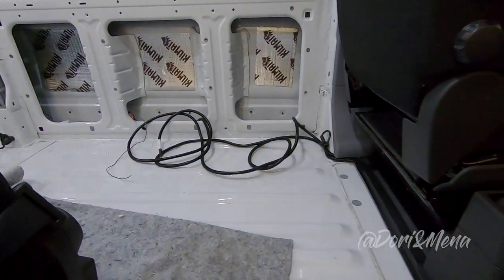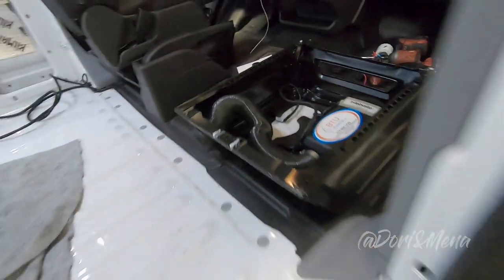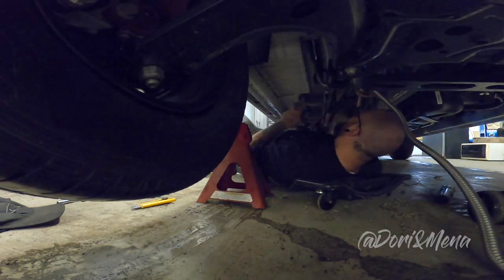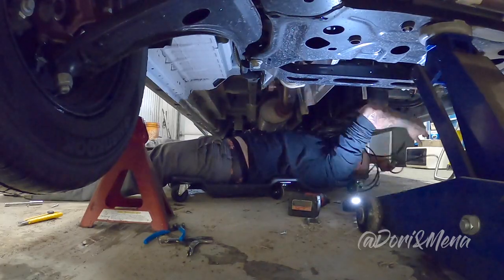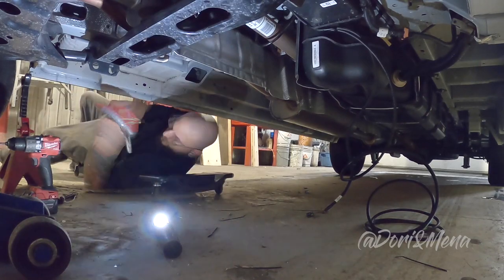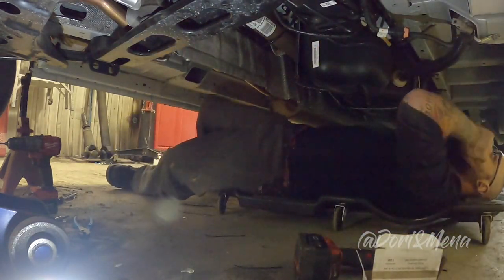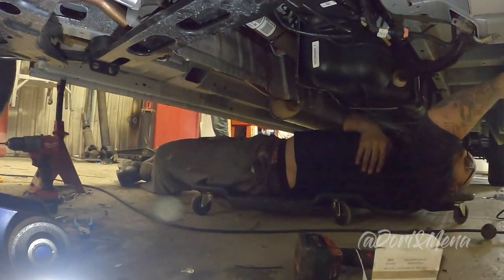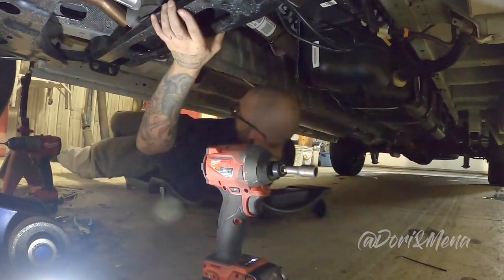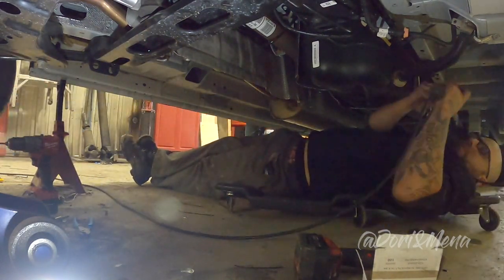Those wires go to the thermostat. This is our Webasto, installed by BTU Mobile. The two red wires are positive and negative — they'll be plugged to the battery. All the wires underneath need to be strapped down properly. For the fuel line we're using zip ties; for the intake and exhaust, mounting brackets. Take your time with this job — you don't want any dangling wires. Make sure your fuel line is not too close to your exhaust system. The kit comes with zip ties and mounting brackets, but don't be afraid to use extra ones if needed.